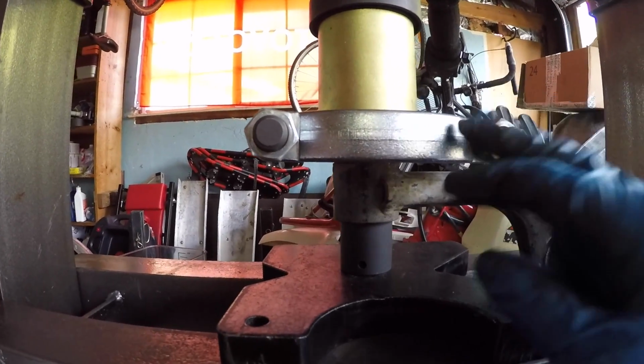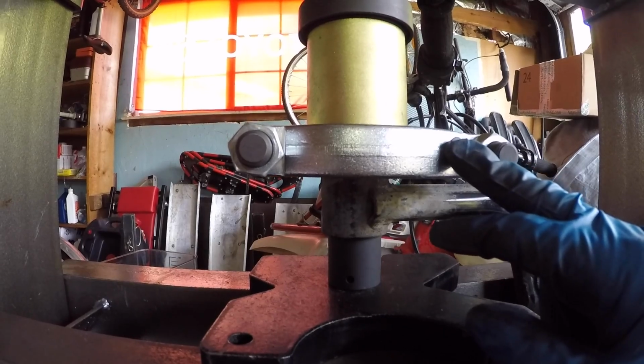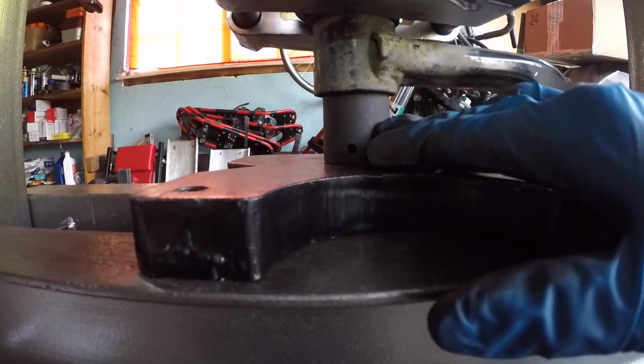We have returning guest Jordan, and we like Jordan, so we're going to help him out with another repair. Jordan wants to replace the bushings in his upper control arm. So just like we showed in part 2 in the lower control arm bushing video series, we're going to utilize our Harbor Freight 20-ton press with the bearing splitter, and we're going to press those bushings out and then use the press to press the new bushings in.